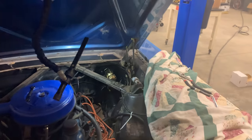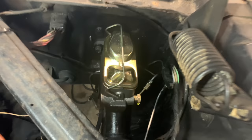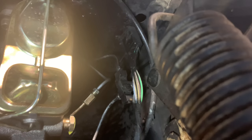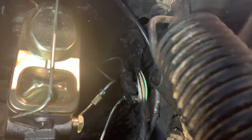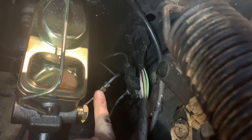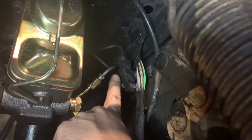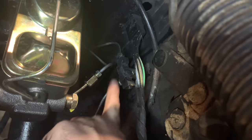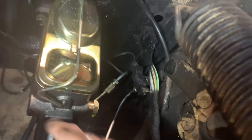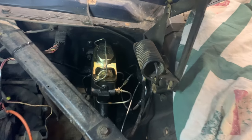The only modification I had to make with this kit was right there where the brake line goes into the other fitting - that's the rear brake line, and it used to go in straight. I had to bend it 90 degrees to get it to fit. It fits and it works and everything's in there. I got all new brake lines going to the back - they're all easy to bend and easy to manipulate. That was the only major thing I had to do, and with all the connections on, that's how it looks.